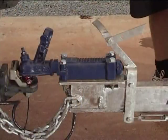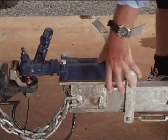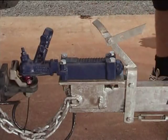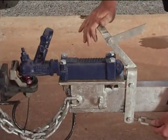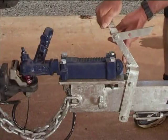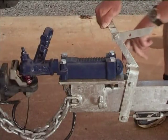As your trailer brakes settle in, the disc pads wear slightly and you'll find that your brakes may need adjustment. When that happens there will be a lot of clunking and banging in the back of the car as the boat moves backwards and forwards on the overrider system. To adjust it, go down and adjust up the tension on the cable until you have about one centimetre gap between the back of the ram and the lever.